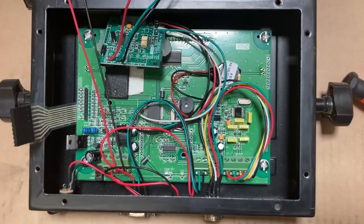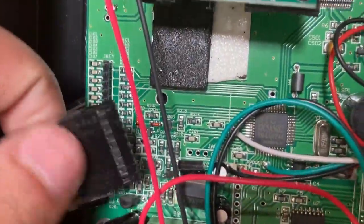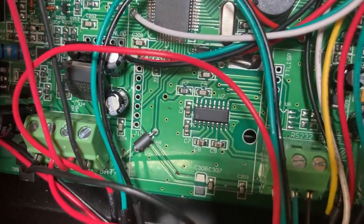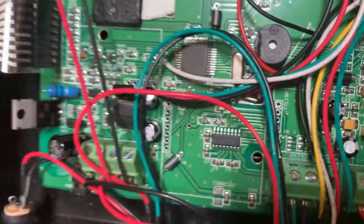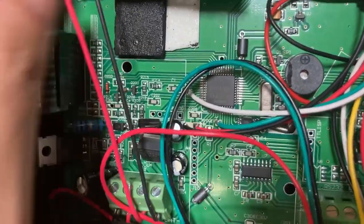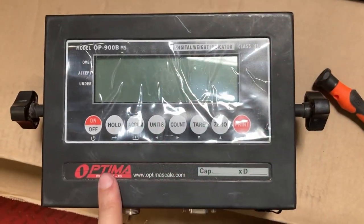Next, we're going to connect the cable. Notice my tan cable came out on the other side, so you'll notice the pinouts — try to line them up and put the connector on. Should be all the way in. Make sure not to move it left and right as that could break the pins — make sure it doesn't break anything.